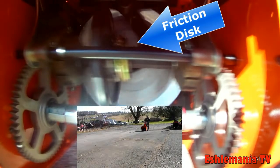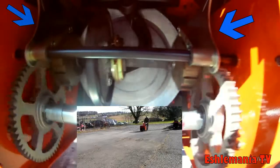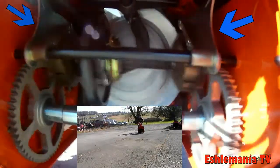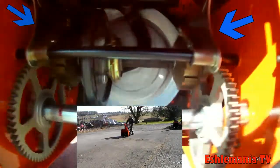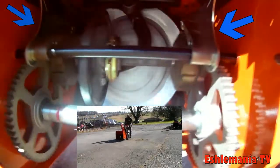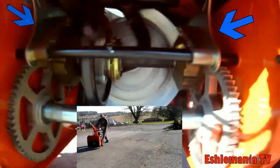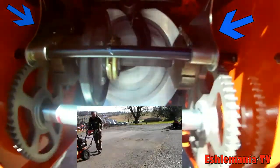Here's a look at how everything inside the drive case on this snowblower works. You can see the video in the bottom middle there — that's what the snowblower is actually doing. You can see how the gears work and how everything works together. You can see the arms lifting up and freeing up the planetary gears. That releases the wheel on that side, which gives you your steering assist by letting the wheel on the other side overpower the non-powered wheel.